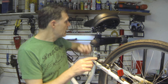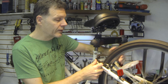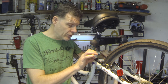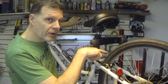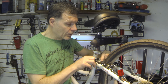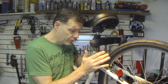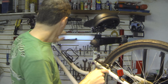The second thing you should know is basic adjustment. If your brake is rubbing on one side or the other, you just need to balance the springs. When you pull the cable, it's fixed on one side — that side is the stop for the noodle — and pulling a length of cable through the noodle squeezes the levers together. An important thing is that the springs that open each arm are independent, and you want the spring tension on both sides to be even. If one spring is stronger, the brake will sit further to one side and rub on your rim.